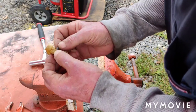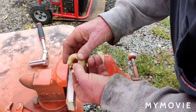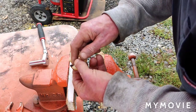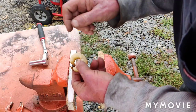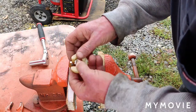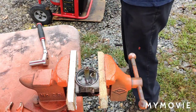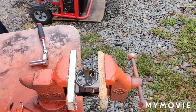What we'll do is I'll clean the seat and everything up with WD-40. Because this is the main thing why I use the WD-40. Because when you use anything that's harsh, like carburetor cleaner, or even brake clean, it's no good for seats, especially with like Briggs & Stratton and Tecumseh, where the seat is actually in the carburetor. I've destroyed a lot of them. I mean, after I saw Mick using the WD, I haven't ruined one seat yet. And plus, I always thought the opposite. For years and years, I thought the opposite. I thought WD-40 was going to be the culprit to ruin any seals, but it's not.